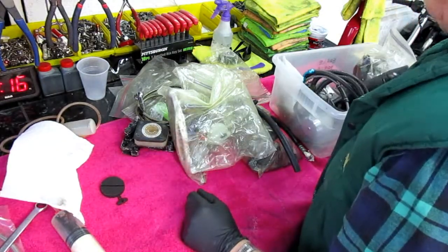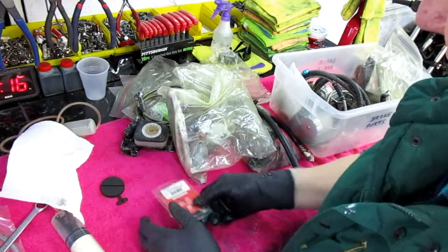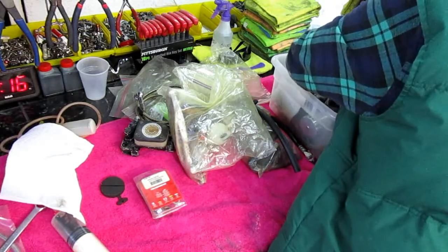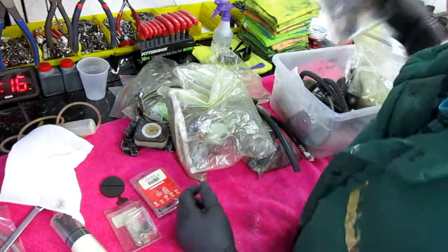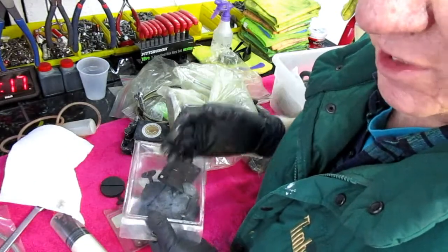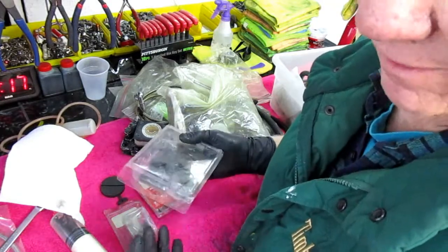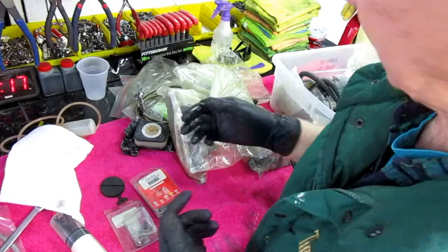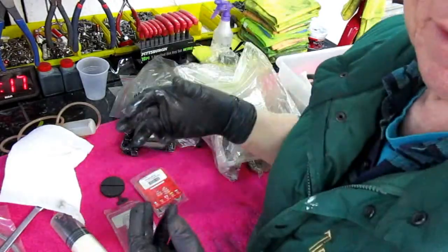I found some new copper washers — that's more than anything what I wanted. If you just don't happen to have new washers, you can take copper ones and anneal them: just heat to cherry red and let cool, like an RD head gasket. They'll be soft again and you can recompress them. I've used washers over, but I don't sleep that good at night — the big thing I don't want is brake fluid getting on my paint. I also took the anodizing off the fitting with a buffing wheel; I'd rather have a shiny part than a red one.